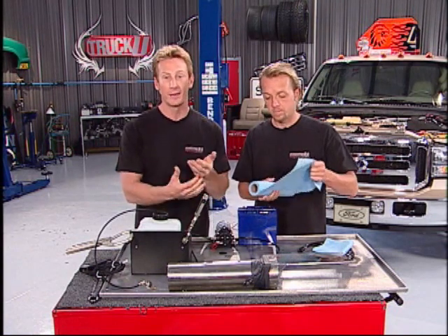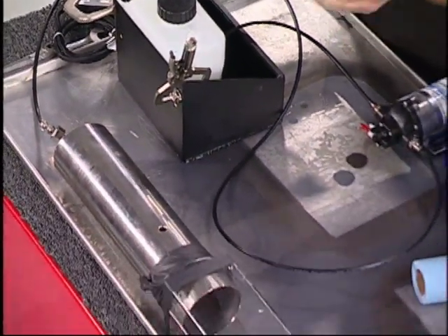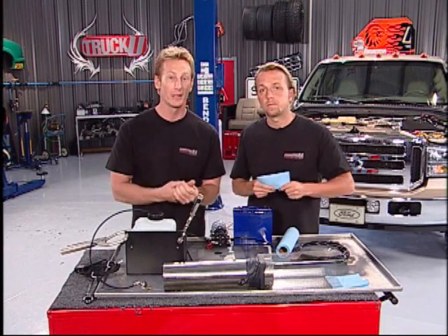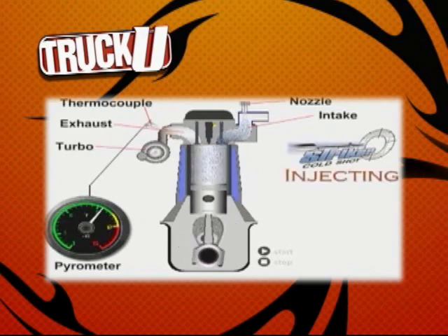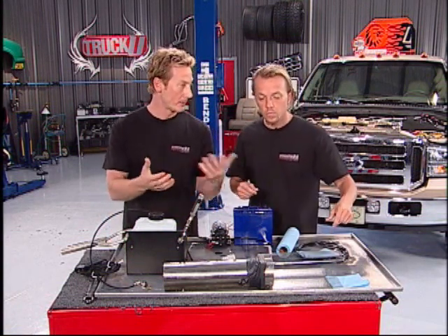People want to put chips in their truck. The chips make more power, but they create a lot more heat. A lot of heat not only creates a point of diminishing returns, but it also wears out and kills turbos. So what we're going to do is use about a 50-50 mix of water and methanol. The water, when it atomizes inside the intake, is going to cool everything down. The methanol has two key benefits — not only is it a cooling agent, but it's also adding more fuel. You add more fuel and you're going to be able to burn it, make more horsepower, so your EGTs are going to go down. Your intake temperature and combustion temperature are going to go down, making a much more efficient working environment. Like going out and jogging when it's 110 degrees — you'd much rather do it at 75. Your engine kind of feels the same way. The air will be more dense, it'll have more oxygen in it, and it'll make more power.